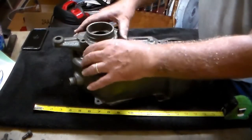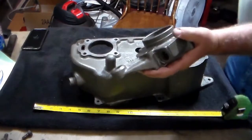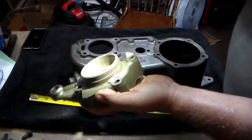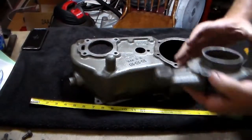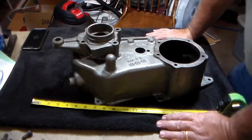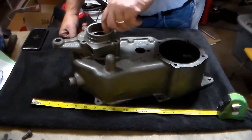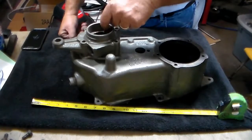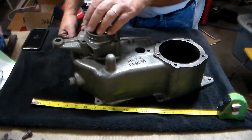If you look inside here, you'll see that someone has heavily damaged the inside edge of this bearing carrier taking out the seal. If you use a proper seal puller, the seal should come right out and you shouldn't have to do anything like that. However, if you take yours apart and find that it's damaged by a previous owner like mine was, just make sure you put plenty of sealant inside there when you install your seal to seal around it. That should be fine. If you've got any heavy protrusions that stick out into the bearing area, make sure to file those down or grind them down so that your seal can fit down inside there without distorting and twisting.